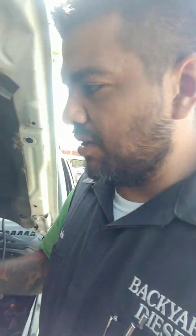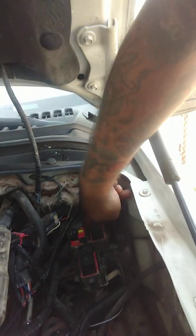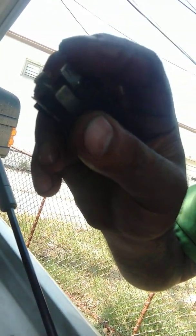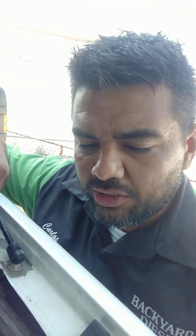I started moving all the cables checking things because I knew something wasn't right. I did the full works — relay, different spots on the 6-liter. There's always a big one when you pull them out, the fatter one with the prongs — that one's hard to get to. The 48-volt fuse to the FICM — everything was good. Now I'm gonna show you where the problem was, which I just found out a little while ago.